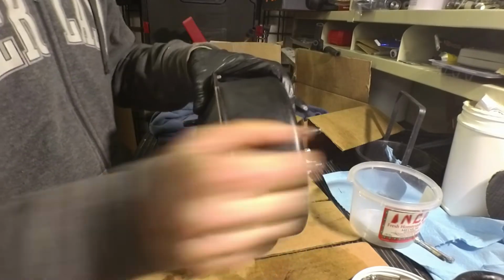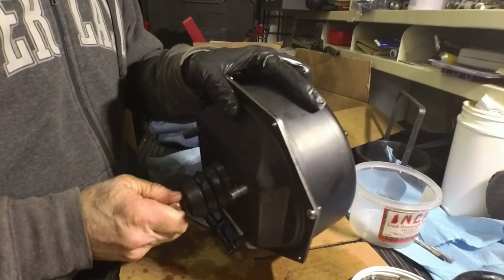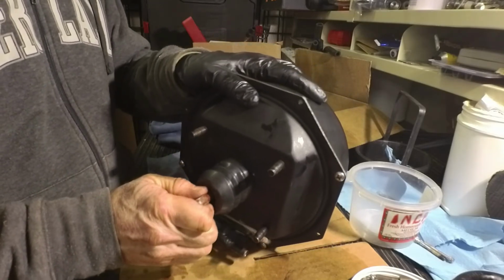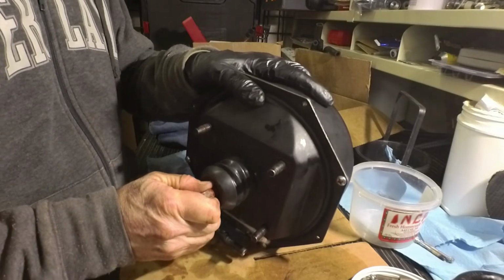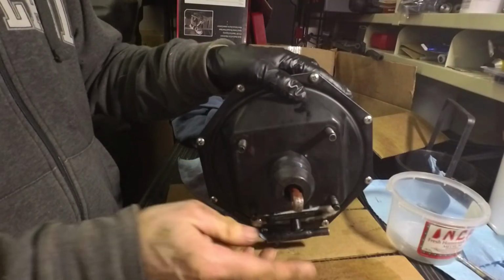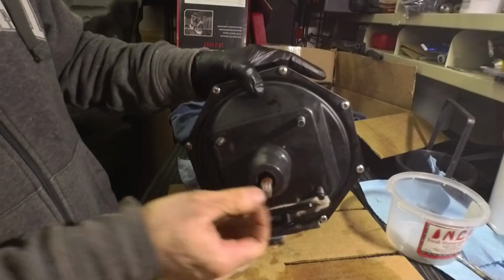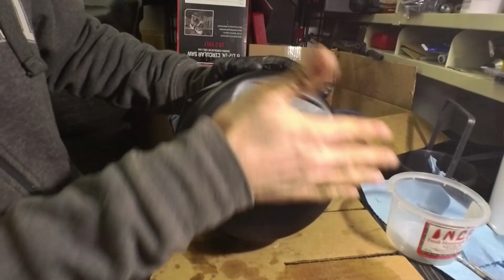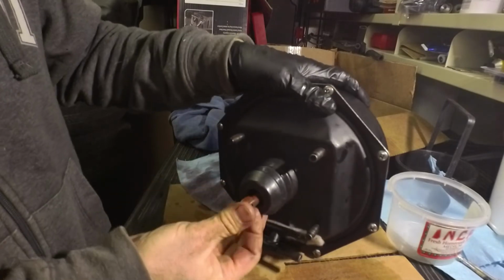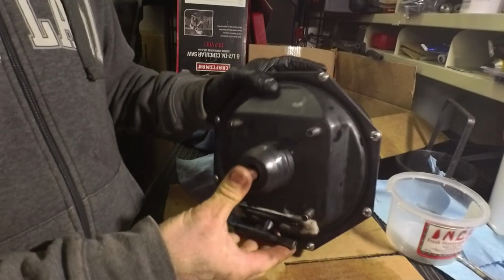So what happens is there's vacuum constantly coming through, and the second you push the plunger, there's a little movement, and that's what locks on the vacuum to do the assist right there. So how this works, so it doesn't just suck vacuum and take it to the floor all the time, when you just barely touch your foot on this, is the master cylinder side, by the way. So this is pushing the master cylinder. So the second you just touch your foot to the brake pedal, there's a little slight movement.